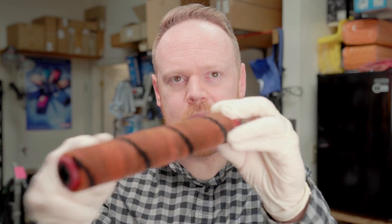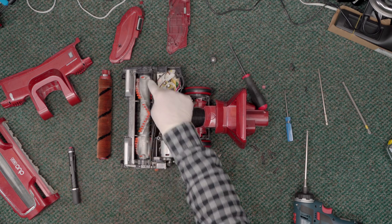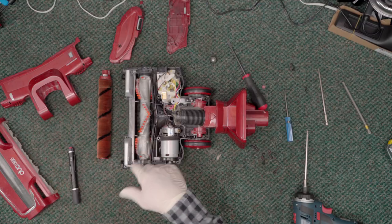In terms of maintenance — these get super dirty. When the soft roller gets grungy, wash it off with dish detergent, wring it out, and wait 24 hours before putting it back on the machine. When you do that, put a drop of oil in the end cap — don't submerge it, just get close to the top when scrubbing. You can buy replacements from Shark if they get too bad. For the brush roll, once you take the hood off you can clean in there, but stay vigilant — you cannot get down into the ends to remove hair. Once hair is in there, it's in there for good and will eventually ruin the brush roll, which means buying the entire nozzle head, and that is almost never worth it unless the vacuum is almost brand new.